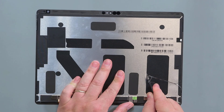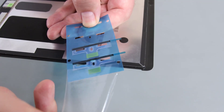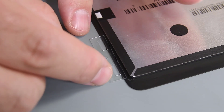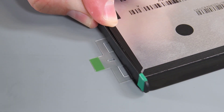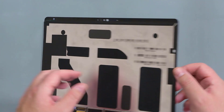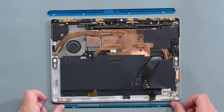If you're reinstalling the same touch display module, remove all the adhesive from the edges of the device and clean it with some isopropyl alcohol and a lint-free cloth. Peel the clear protective liner from the replacement speaker mesh pack and remove a speaker mesh and handle. Remove its blue liner, and then orient the speaker mesh so that the exposed adhesive is face down. Press it into place, and then use the side of your tweezers to press down on the mesh for 10 seconds, allowing the adhesive to activate. Repeat this process on the other side. Flip the display module over to verify that the meshes are aligned properly. Lay out your replacement adhesive strips with the blue liner facing up, making sure the adhesive follows the outline of the case.